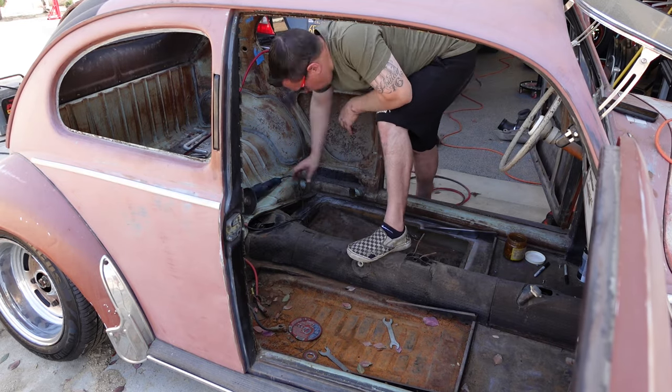Body work on the oval clip is 100% done. Next video, I'm gonna do one last color sanding of this black primer, and then we're gonna shoot the final color on it, which is kind of a slash between a ruby red and a rust red primer. The bug's color is a ruby red. But there's also rust red primer in certain areas, so it kind of makes it difficult. I can't do straight rust red primer, so I'm going to have this color matched when I shoot this and then blend it in. So you'll see me do that in the next episode.